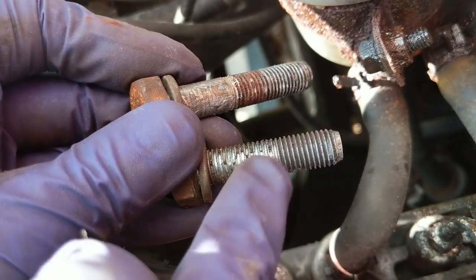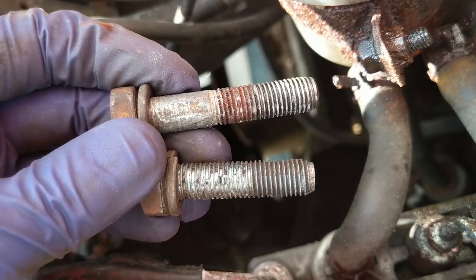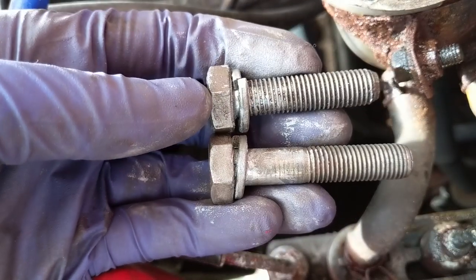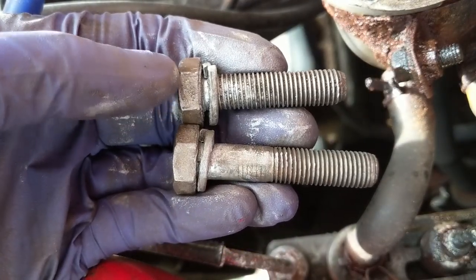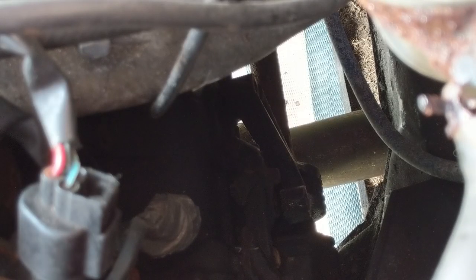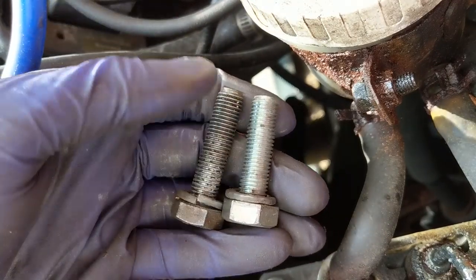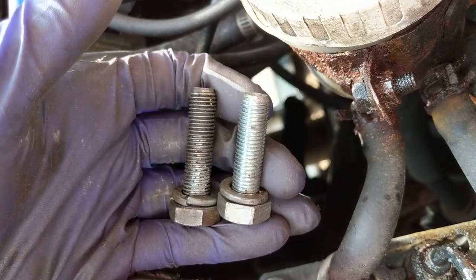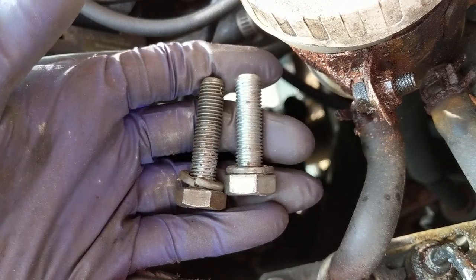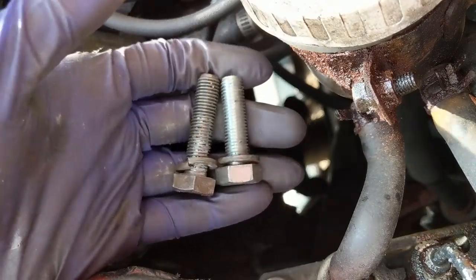The driver's side bolt is a little bit shorter, while the passenger bolt has more unthreaded length and is a bit longer. But these are not the correct bolts — I went online and looked it up. They're both supposed to look more like this one, but neither are Mitsubishi bolts; they're hardware store bolts. I have an entire bin of DSM bolts from parting out a DSM with my subscriber Caleb. The torque spec for the carrier bearing is 26 to 33 foot-pounds, so I've got my torque wrench set to 30. The threads on the longer bolt were damaged, so I'm going with another hardware store bolt — it looks nicer, and I'll replace these later anyway.